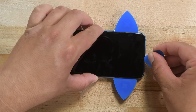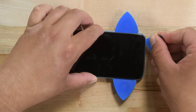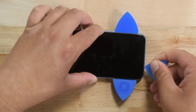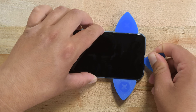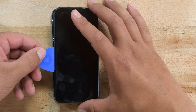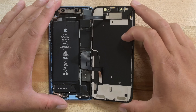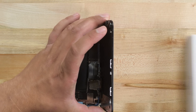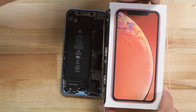The top edge of the display is held with both adhesive and clips, so gently pull the right edge of the display down slightly towards the lightning port and insert your pick in the top right corner. While gently pulling down, slide the pick across the top edge of the iPhone and cut all the adhesive. Now all the adhesive should be separated. Open the iPhone by swinging the display up from the left side, kind of like the back cover of a book, but don't try to lift it all the way off — it's still attached with ribbon cables. Grab something to prop up the display, like an old iPhone box, and you can use a rubber band to hold it there.